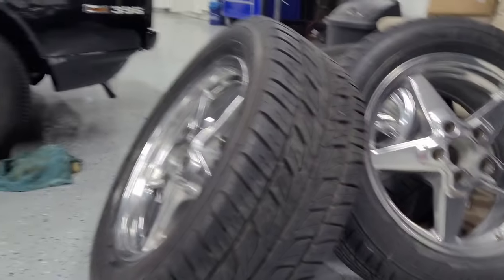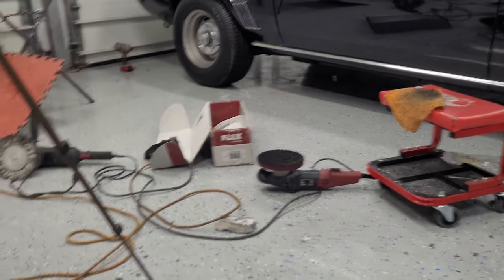Guys, so we just finished up polishing stage with the white pad there. So now it's time for the Zephyr Pro 40. Basically, what you do with this is probably what you guys who have polished aluminum or steel or whatever before are familiar with. Same process, just buff it on with a towel. So I'm gonna use a microfiber towel like this one, except clean. Buff it on till the surface turns black and then just buff it off.